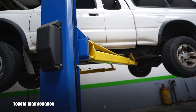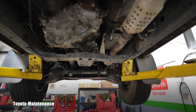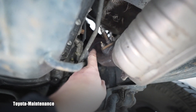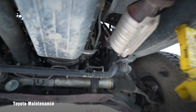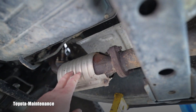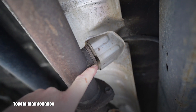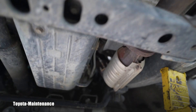It's a V6 engine, 5VZ-FE, and she had three codes. We will be looking at the oxygen sensor or AF sensor. The first one — upstream, bank 1 sensor 1 — is on the exhaust. The second one is past the catalytic converter, which is right here, hidden with a shield, but the wire is coming into the cabin this way.